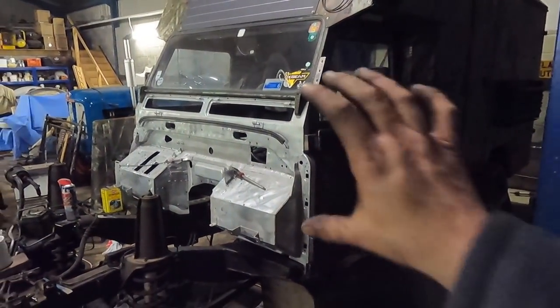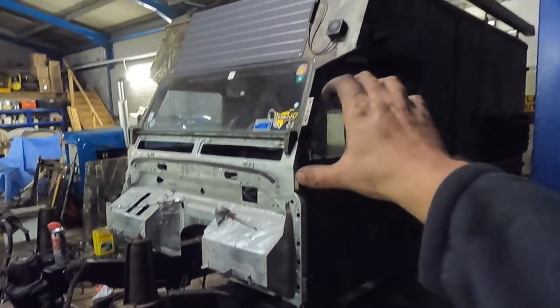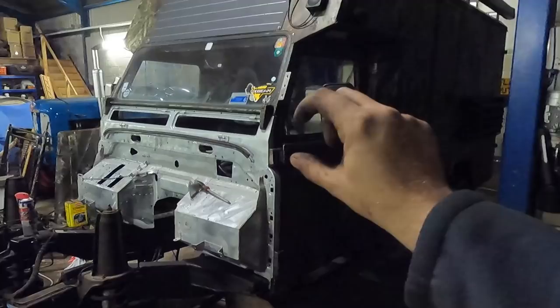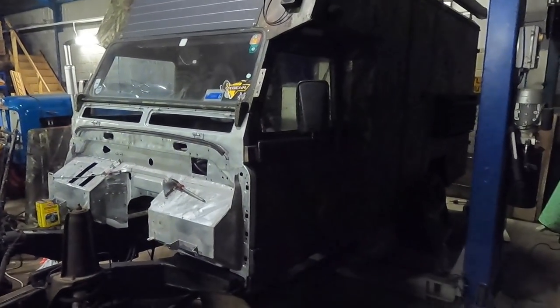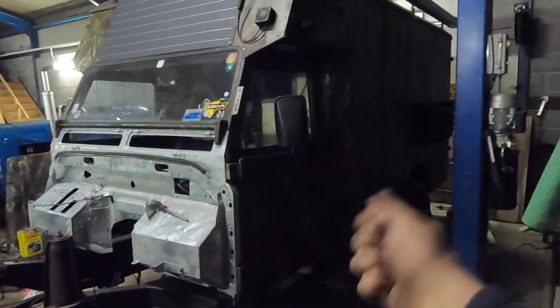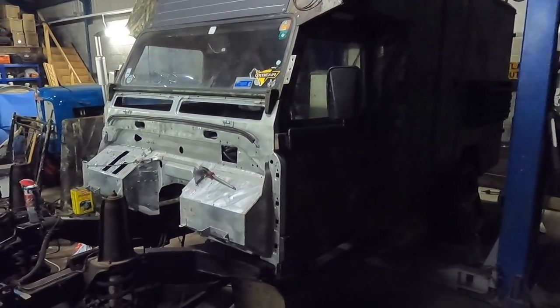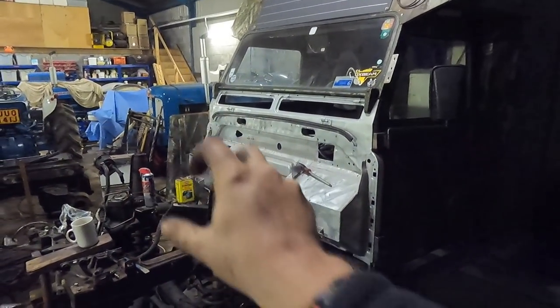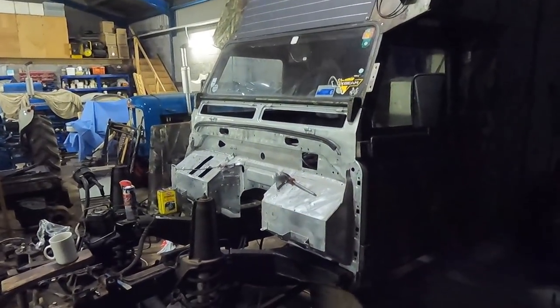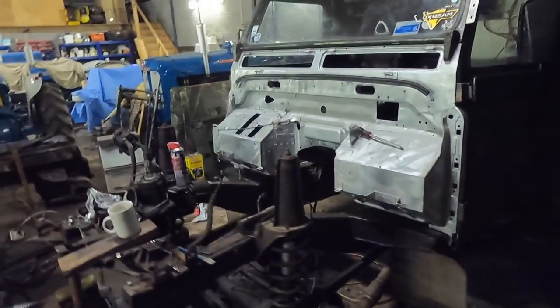Alright, that's enough for tonight. The bolts at the bottom are a bit loose, the windscreen's pulled back down, and we've roughly put the doors on — unlocked for now. A few bolts need redoing and the door needs hanging so it shuts nicely. Once that's done the bulkhead can be all tightened up everywhere, make sure it's sat right, doors open and shut okay, and that bit's done. Then it's getting the engine back down, welding the engine mounting where everything should be, and from there building it back up — dashboard, wiring loom, heater box, power steering, all that job. If any of this is any use to you, give us a thumbs up and a comment, and we'll see you on the next one. Thanks for watching.